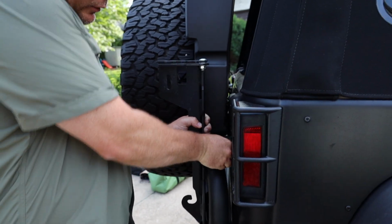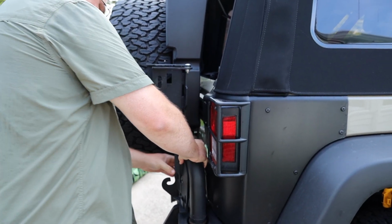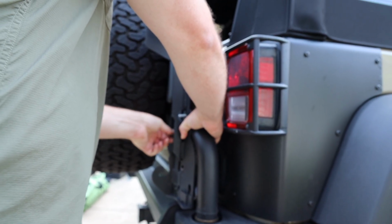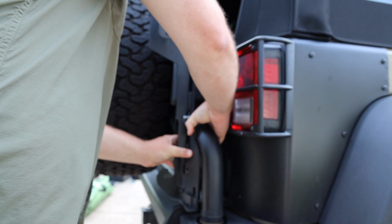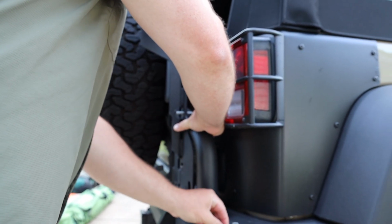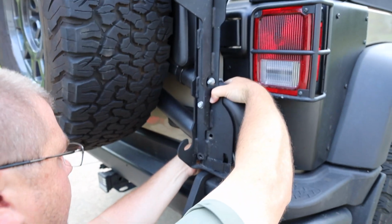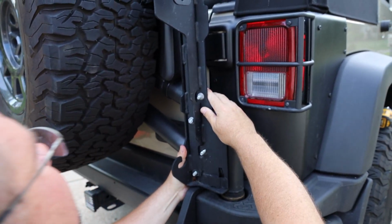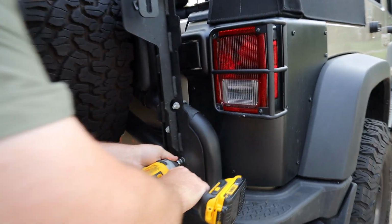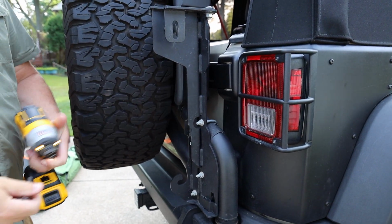So you come around, bring the U-bolt around the top, around the top bar. Try to get it as even as you can. And just start these bolts. What you're going to want to do is try to get the bolts as even as possible and torque them down together, one at a time, but slowly, but try to keep it as evenly as possible. And same thing with the bottom one. Just coming around from the back. Try to get it as level as possible. And slow. Let's get these. It's nice and secure, and that's all you have to do to install it.